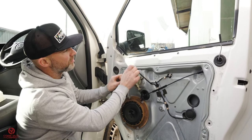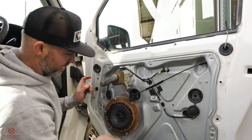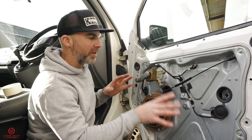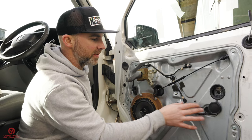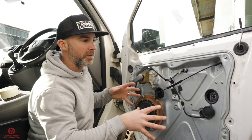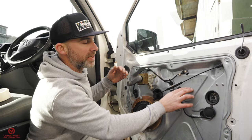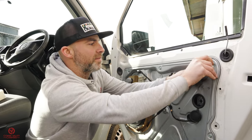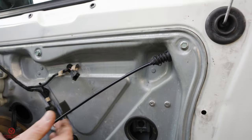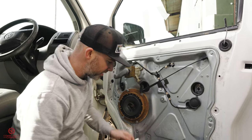Once the glass is taped up, wind the handles as if winding the window back down. Now undo all the nuts — you can see someone's already been in here and fitted some speakers; we'll get proper speaker pods later. Some wires may need to be disconnected from the door panel. You can disconnect the entire loom and thread it through the door, but for today we just need to unclip a few to give the panel some movement. Loosen the rubber grommet and sleeve so the cable feeds through when pulling the door panel down. Undo all the 10mm bolts, keep them safe, and the panel should come off.